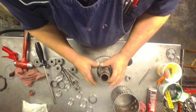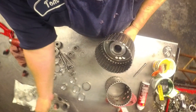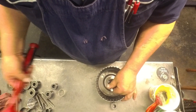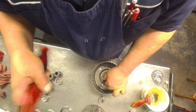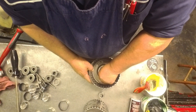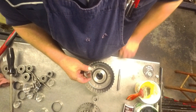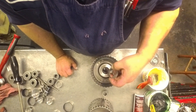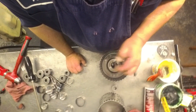We'll see how it fits on here. It went much better — we can turn it, so we're good there. On this 6R80 equivalent of this hub, right underneath this bushing there's a sleeve that's pressed into the shell. If you just go driving down on that and it hits that sleeve, it'll grab the lip and bend it out — then you've just ruined it. So you've got to be careful what's underneath the bushing also.